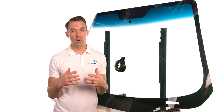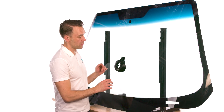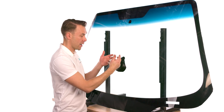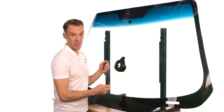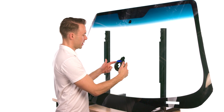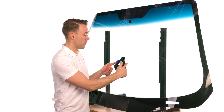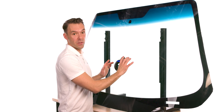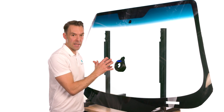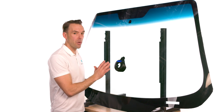The ProCure Smart Light also works great for small to medium and even long crack repairs. For long crack repair, it's important that your suction cup have a decent distance from the curable area so you don't put too much pressure on the crack — with the ProCure Smart, you've got several good inches between the suction cup and the curing area. A typical long crack repair is four to six inches, which you can cover in one pass or by moving the light two or three times. The preset 30-second cycle is usually all that's needed, and the smart temperature technology will auto-adjust in extreme climates.